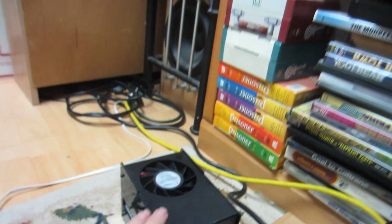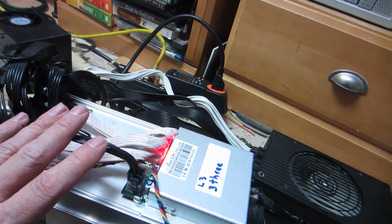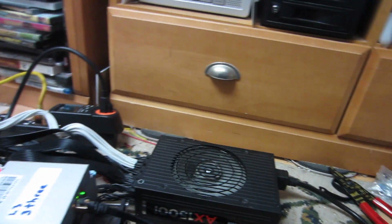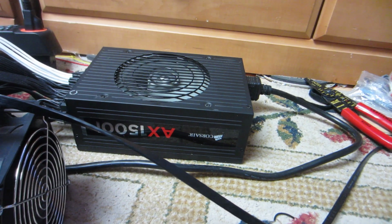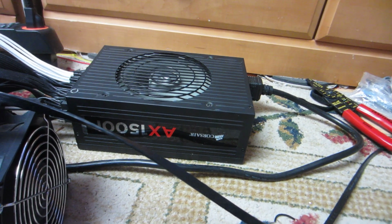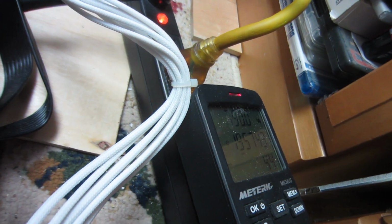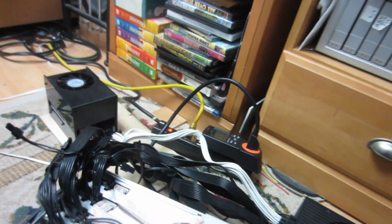There's really nothing out there when you combine the two that does watts that low. The unit here does maybe 110 watts, and this unit is doing roughly 675 watts. Of course, that is with an ATX titanium PSU. If you didn't have titanium and you had a platinum, over here you probably wouldn't be reading 790 or 789. You'd probably be reading maybe 825. But very happy with this setup, and as you can see, it's pretty quiet.